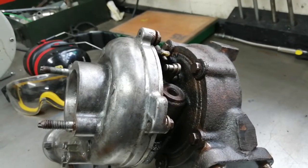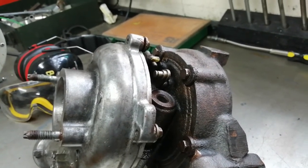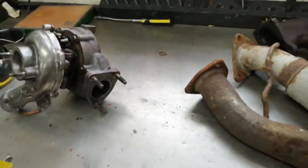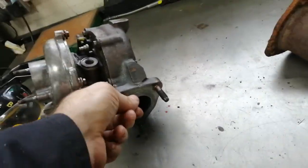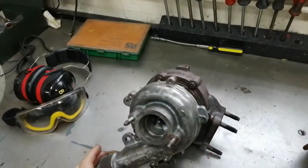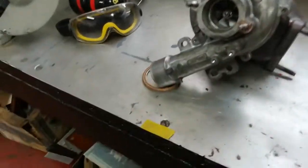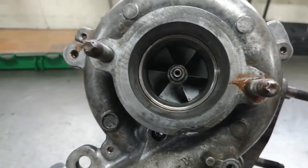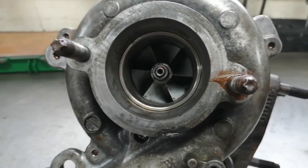It comes with a three-bar sensing valve and a vacuum valve, and it's pretty generic — a triangle design, very similar to a GTV. The turbo has a six-blade compressor wheel — six/six actually — and it's got two steps.